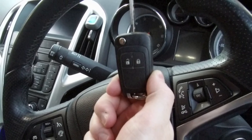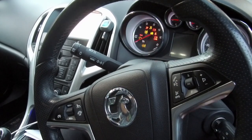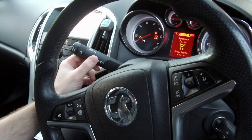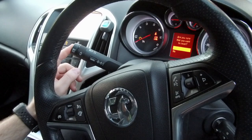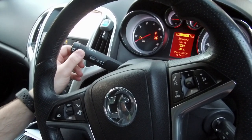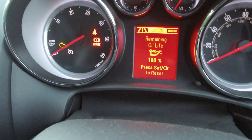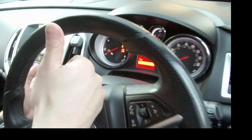Last thing to do — we have to reset the oil remaining life and we will do it using just the instrument cluster. Turn the ignition on, switch to the next view with the menu button. We have to be on the middle menu screen. With the slip ring switch, set it to remaining oil life, then press the set button. Switch to the yes position and confirm it with the set button again. And job done! If you like it, thumbs up and subscribe. Thanks for watching!